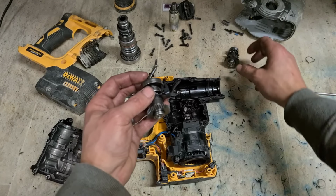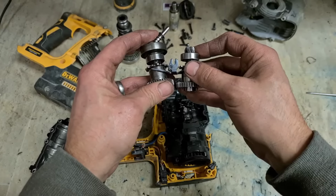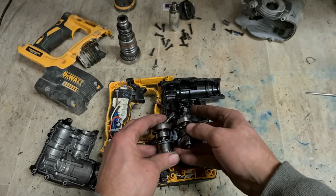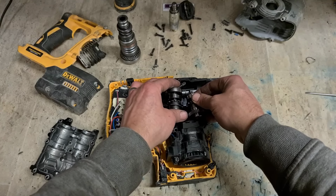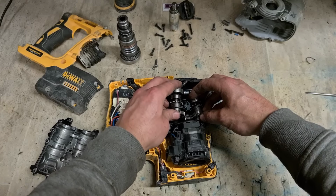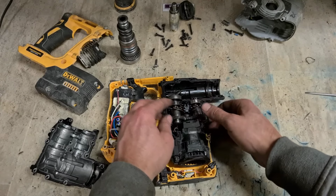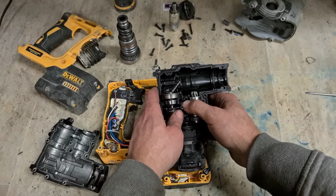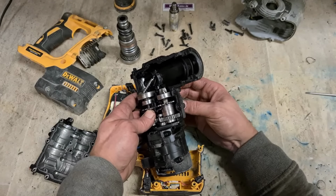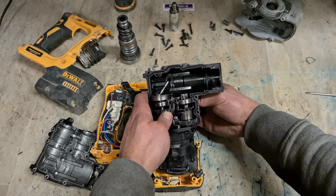Put your pin in here. Get your two gears together. And this wee adjuster goes to this side, and drop these on whilst putting this pin onto this hole. And I'll worry about the grease later. Also make sure for the selector, the pin moves it, connected at the back, that it's actually engaged. Just push on your change lever and rotate it until it drops on.